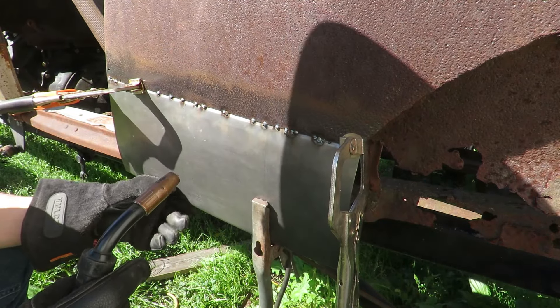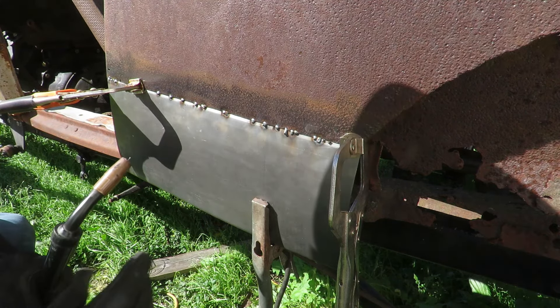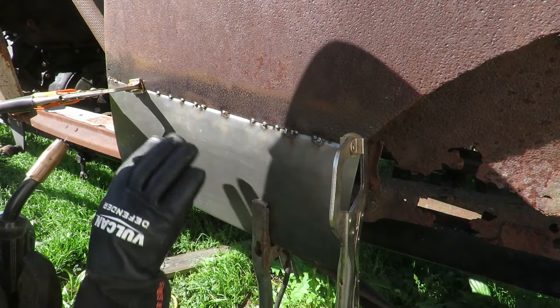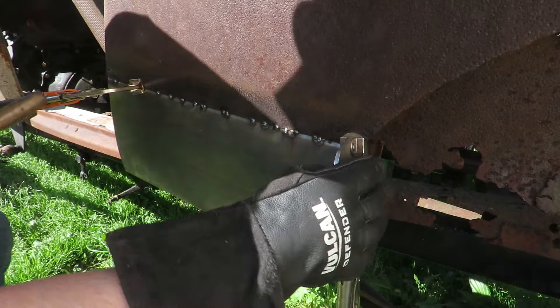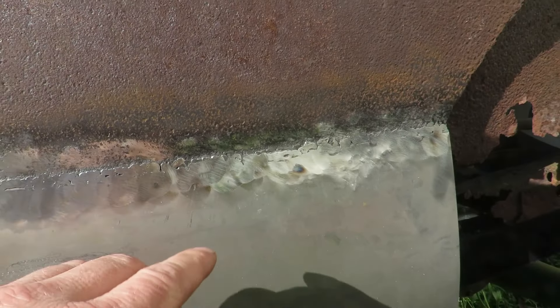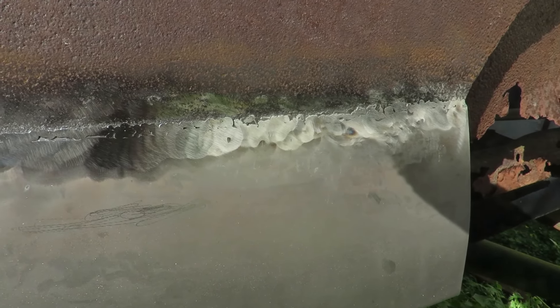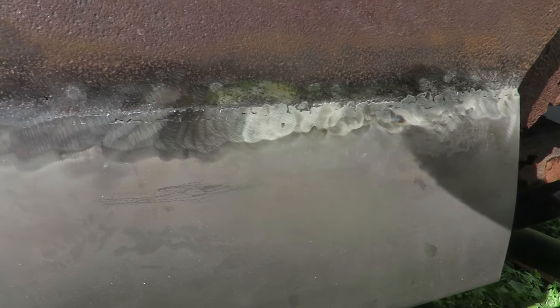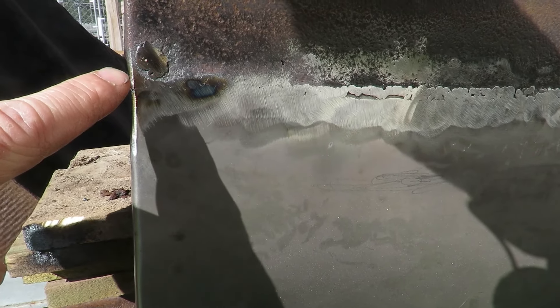I'm going to go ahead and go on the inside and just hit a couple welds in there, and then we'll start slowly popping tacks along the whole entire side so that it doesn't kind of warp or anything crazy like that. I got the area tack welded and welded up, then I ground the weld down and tried to use the hammer and dolly on it a little bit to kind of get them back even. Turned out better than the other side for sure. Still, I've got to work on the hammer and dolly stuff — I got to figure that all out. I had one area right here that kept popping through.